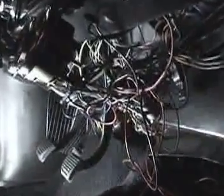So far all we've done is show you what we're dealing with underneath the hood of the car. Then I came inside the car and I found all this right here. This is a really big mess. This is spaghetti. Lots of cutting and splicing, lots of Scotchlocks, lots of zip ties, lots of shrink tube. This is a disaster waiting to happen right here. Even if you look past there, over here at our pedals, you can see all of our turn signal wiring and connections are all cut and spliced, zip tied to the steering column. That's all got to come out.